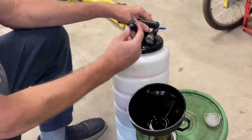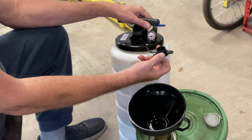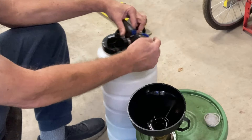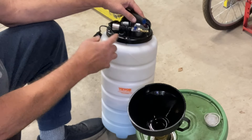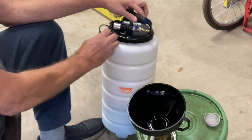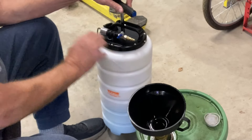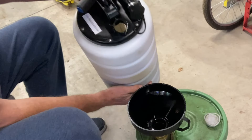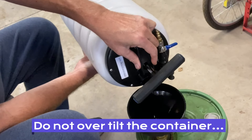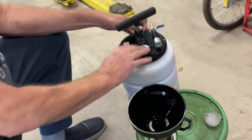Just as a reminder: this is the cap that plugs the hole when the extractor isn't in use. When you unplug it and want to use it manually, you have to put the cap on the chrome muffler port. If you're using air, don't put the cap there — that's where air blows through with the venturi effect to create vacuum. But when manually pumping with the hand pump, put this cap on there. Final step: pour the extracted oil out into a five-gallon jug for disposal. Thanks for watching — see you at the next video.